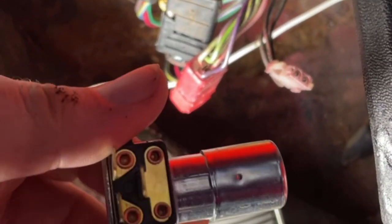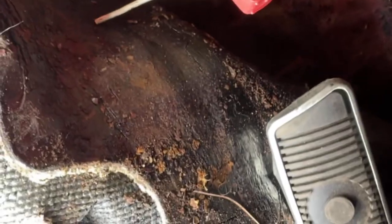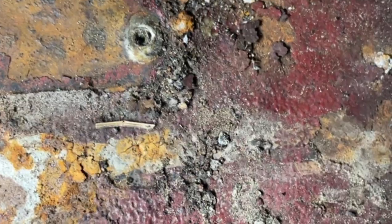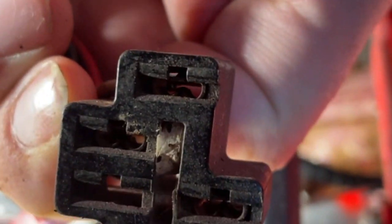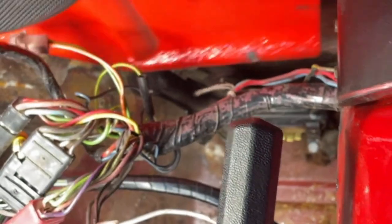Since we're going to be putting all this new wiring in, I went ahead and bought a new dimmer switch. We're going to mount it — I had to pull the carpet back so you can see on the floorboard where the dimmer switch mounts. It's a bit awkward because those holes are really close to the side, which means you need to put the connector on first before you screw it in, otherwise you don't have enough room. So we come down here to our wiring harness end and find a three-wire connector — that's the one that's going to go on there.